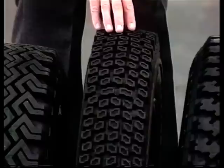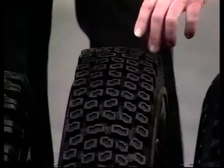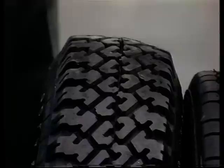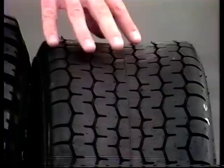What about that thing? This is very knobbly. That tire actually is designed for studding originally, but studs are fading out because they're doing damage to the road. It is designed now because of these suction cups here. On the RAC rally, on packed snow and ice, they act as suction and grip on the ice and attract good traction. So this is an expensive, highly specialized tire for snow and ice? Yes. What about that one? This tire is in a different compound. It is our best rally special stage tire. It's used by Tony Fall, and it is a soft compound for performance. And in the dry, it does 12 miles to a special stage on the rear of a car. It can actually wear a tire out in 12 miles.